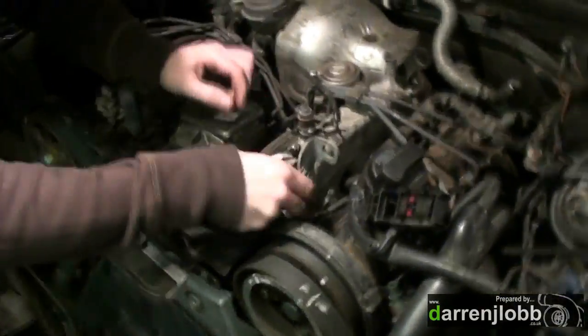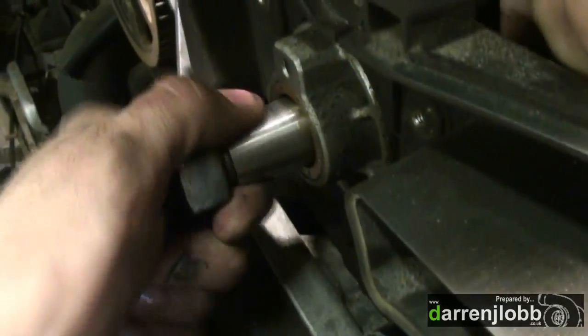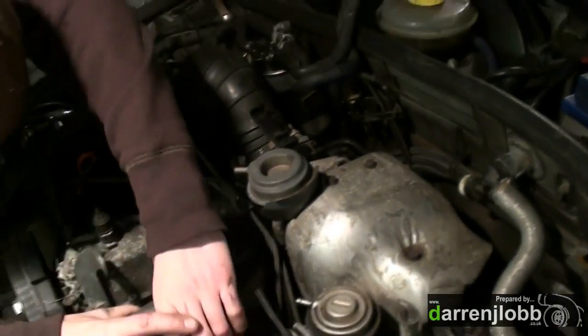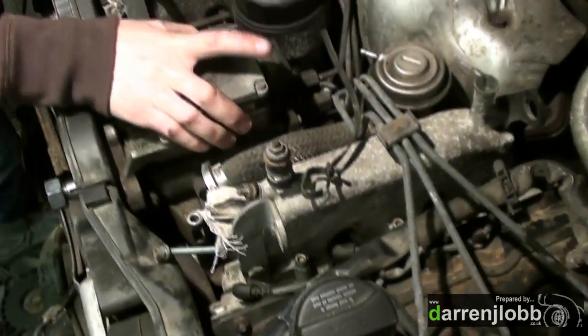Right, we're just in the process of getting the pump off. I took the cam belt off — it's a base-mount pump, VP44 — so just whip the four allen keys out, got the pulley off the front. That's the pulley we've somehow got to modify to fit a VE. As you've noticed, that shaft is massive compared to even a 17 or 19 mil VE shaft, so that's going to take some mods, but it shouldn't take long. We've got to get a VE in there, which is a slight issue because the turbo's in the way — we might have to move the turbo. I'm thinking we'll just accidentally put a big one in and mount it back there, cut that bulkhead out. Looks like the pumping lines are coming out completely. She's coming out, boys.